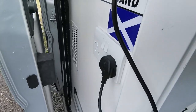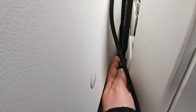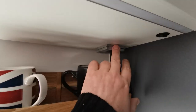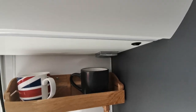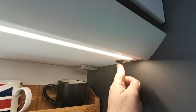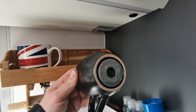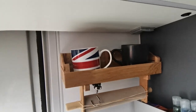I've added a socket on the kitchen side accessible even when the door is closed - just enough room to get my hand down to plug in a kettle or toaster. You can wire this by going underneath the cupboards, up behind the fridge, and spurring into the socket Adria put in up there - I took the fridge out and put a junction box in. There's also two-way switched LED lighting throughout, and I've made a little shelf for cups, with neodymium magnets underneath to keep the cups in place while driving.